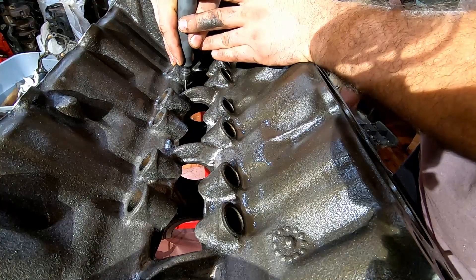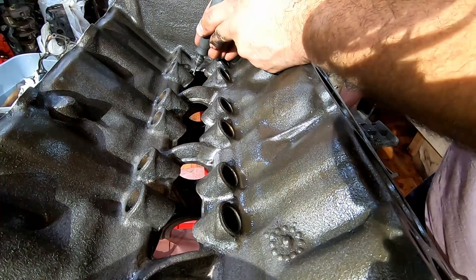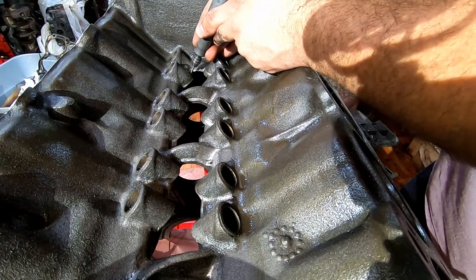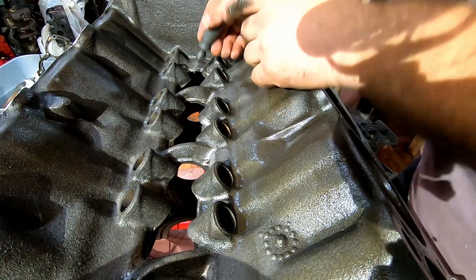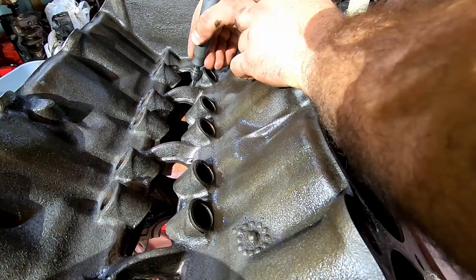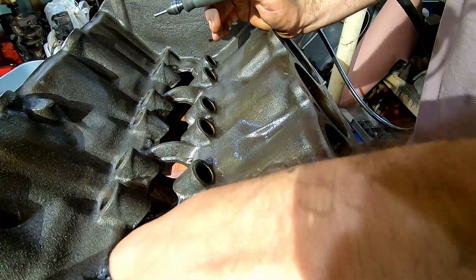Use two hands so if she tries to get away you can wrangle it in very quickly. Help with the transitions; don't take a lot of metal off, just a little bite. There are definitely no happy mistakes here — if you make a mistake you have a bad time, so just like that, that's all it took. Be very careful, use two hands, don't let it get away from you, and constantly check your surfaces to make sure you're not going past what you intend to remove.